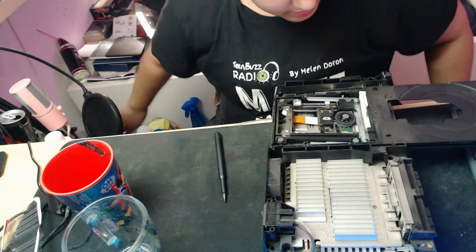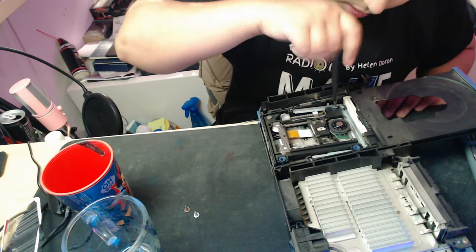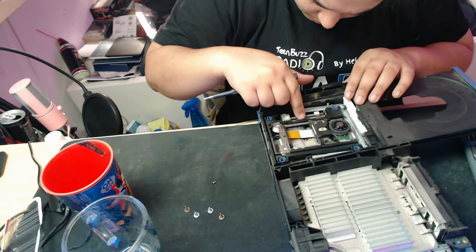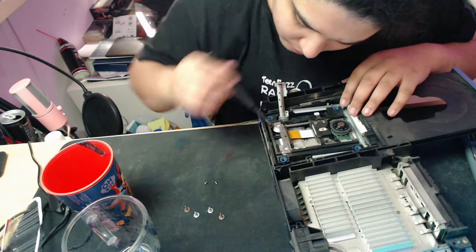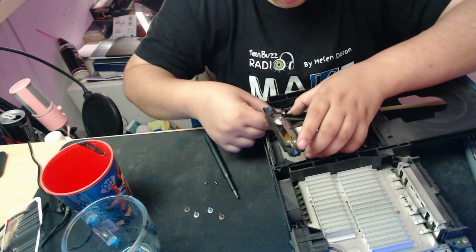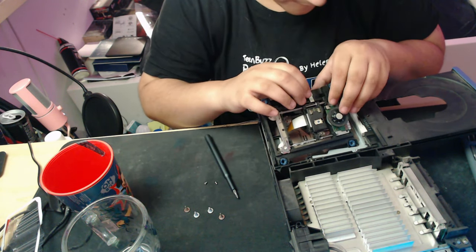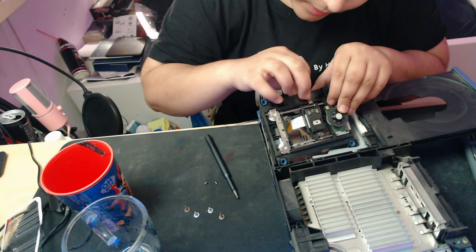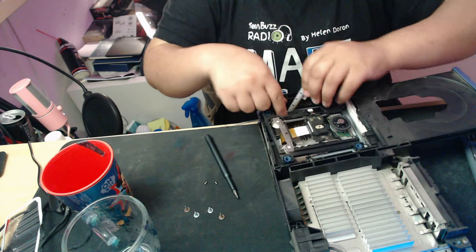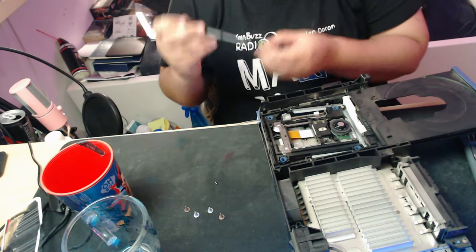The biggest issue is that the mechanism that's being used has just gotten worn out a little bit. So we're going to take off these four screws that hold in this bay right there — it holds in the bracket. And then there are these two screws that hold in that little rotator thing that rotates the laser. There are these two tabs again that you have to push out at the bottom to take out the bracket. This white tab right here is the part that is a little bit worn down. You want to just push that straight down with some regular force — not all the way down, but just a little bit — and that will add the tension we need to get that strength for the drive to open and close.